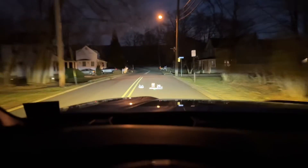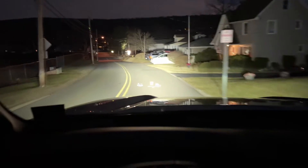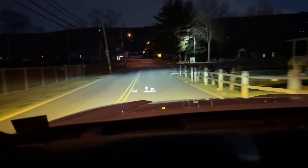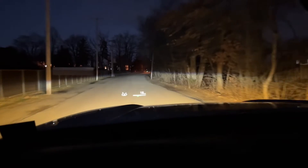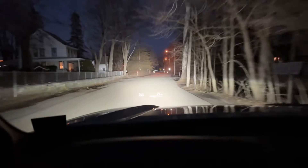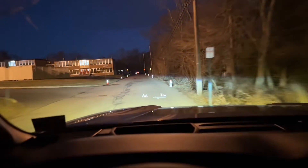Quick add-on to the video — here's a chance to see these light bars in action on some local roads. Check out the SS6 as well, those are really nice. Factory fogs turn off when the high beams are on. The SS6 have a great spread and my lights are aimed very properly. The truck is lifted so I made an adjustment — it still gets good range without blinding anybody. I've got full control with the headlight stalk, and I can just leave it on auto, though sometimes the system doesn't switch to auto high beam as quickly as I'd like.